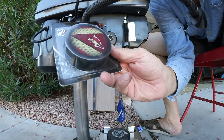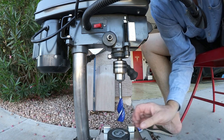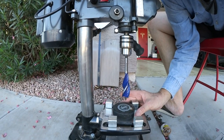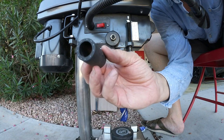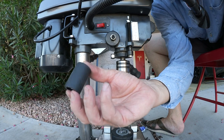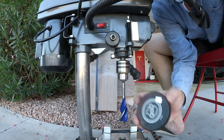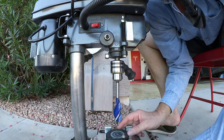So what do you take? Ice hockey pucks — preferable Phoenix Coyotes. With this ice hockey puck, put it on a drill stand and buy additional pieces of one-inch rubber, pre-cut one-inch thick and about two inches long or a little bit longer. Then drill a hole in the center of this ice hockey puck, all the way firm in, aiming to the center.